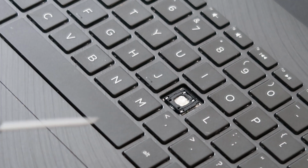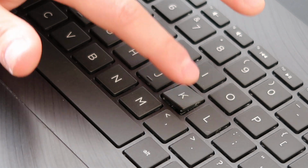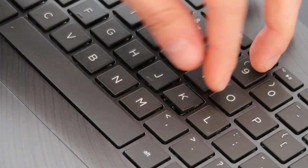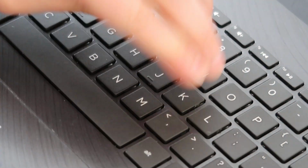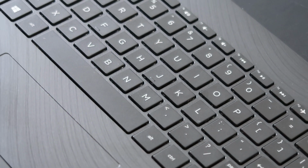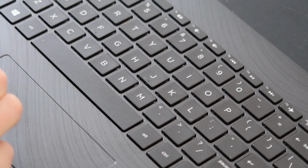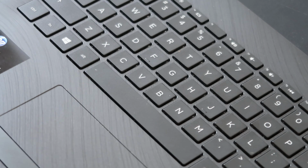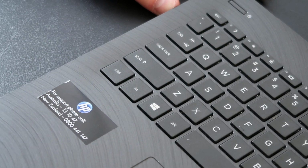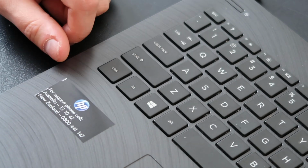Just like that. And now that's secure, you put your keycap on, center that as much as possible, and then just press that in. And that snaps in. So there you go, that's how you would salvage a key off of a keyboard, and that's how you would install it to work as well. So now, as we said, the other keys are a little different here. The larger shift keys and space and backspace look different.